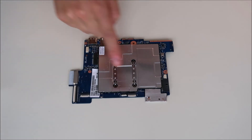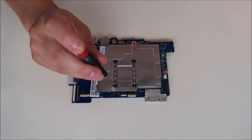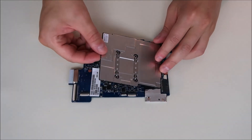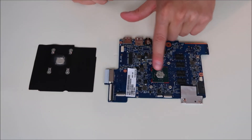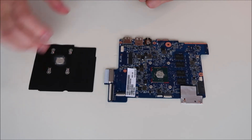As you can see, the heatsink assembly is not very complicated in this computer. You don't see a fan or any large copper components — that's because this is a small computer that doesn't produce much heat and doesn't need a big heatsink. To access your CPU, we take out these four screws holding the heatsink down, and it comes right up. There's your CPU. As you can see, it's not easily removable — it's integrated into the motherboard, so you can't easily take it out and replace it. But that's where you'd find your CPU if you wanted to clean it or apply thermal paste.